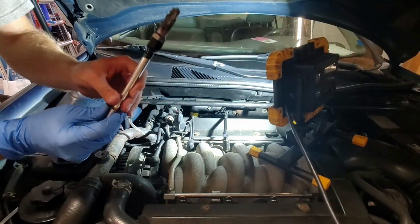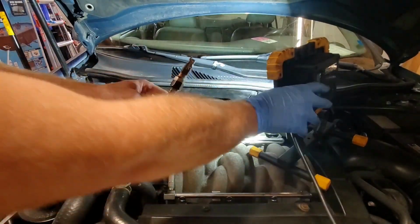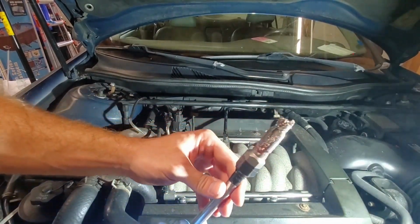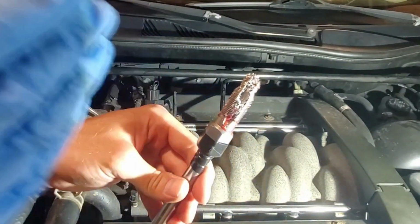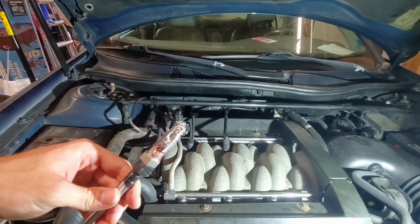A few moments later. All right, guys, check that out. So this is why we used, hopefully you can see that, this is why we used that hard grease. See all of those metal shavings in the flutes of the bit? It is just jam packed in there. If you did not use this grease, it would have fallen into the cylinder head or into the cylinder bore and with your piston and your valves.